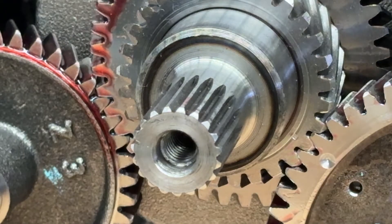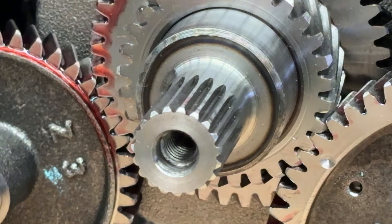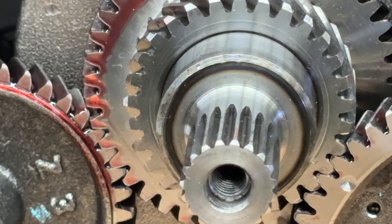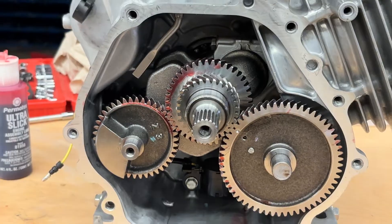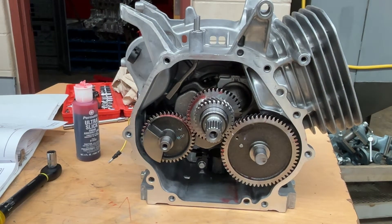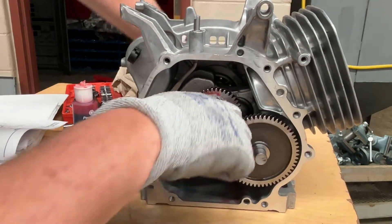This is timing — when those valves are opening and closing. If you don't have that timing right, the valve opens at the wrong time and smashes into the piston. So those two timing marks are critical. I'm going to zoom back out and we're going to double-check this again.